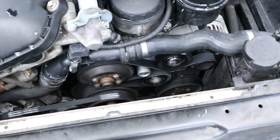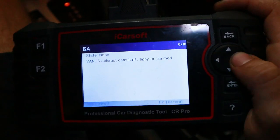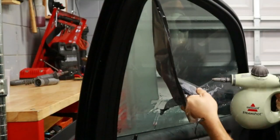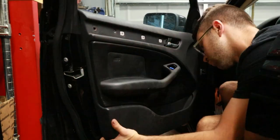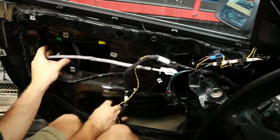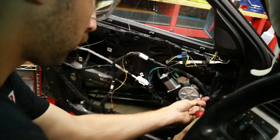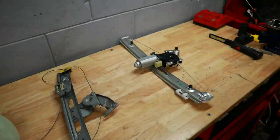Once those belts were running smoothly, my next priority was to scan the car and see exactly what codes it had. It had a few codes for misfires and some VANOS codes, but I figured this was because the oil was so old and dirty, so I went ahead and did an oil change immediately. Then we moved on to doing the window regulators — I bought all four brand new window regulators from Amazon for a fraction of the price of OEM ones, and we went on a mission to change all of them. Now all our windows work great.